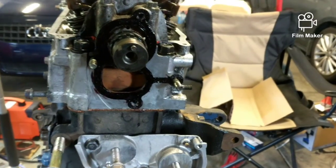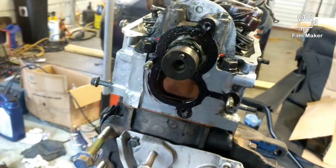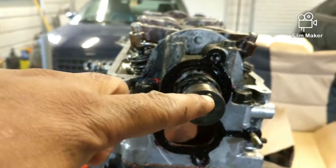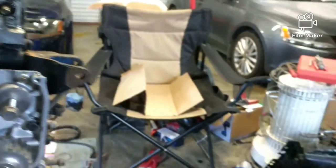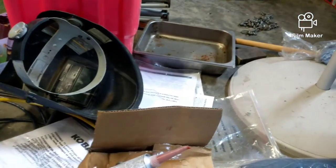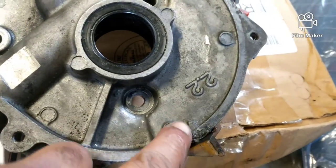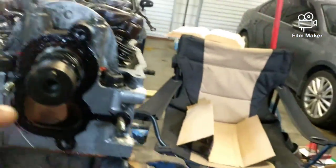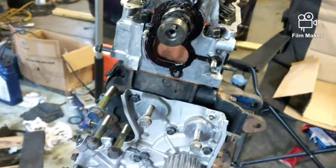That's the housing to the distributor, the distributor gear, and it comes together right in that area. And I'm gonna put this in red, or I can leave that, but I'll have to put where it is on the other side, that little beak in red, just so we all know that's where the timing goes, this little dot. I'll wait on this to dry up.